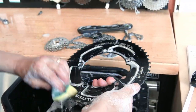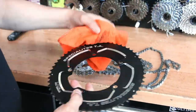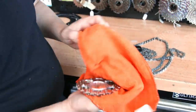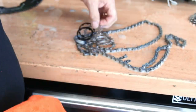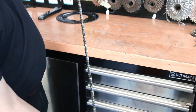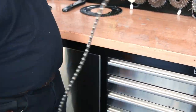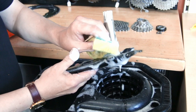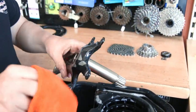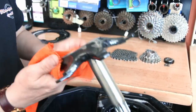And then this was the chainring he'd bought — he'd gone to a 1x system. I'm not a great fan of putting that onto an original 2x chainset like he had, because the 2x chainset — the spacing of the bolts and the lugs and everything — is geared for allowing it not to cross-chain. With a larger ring only, you're cross-chaining slightly to the larger cogs on the rear, but that's the compromise you make, and that's the compromise in this job.